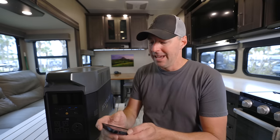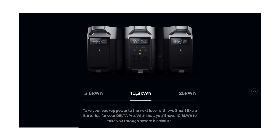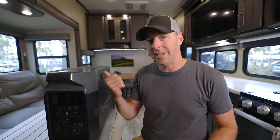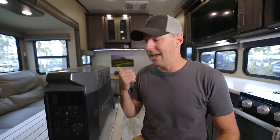If you tried to duplicate our external battery setup, adding one extra battery would bring you to just over five and a third batteries worth of capacity. You can actually scale this all the way up to 25,000 watt-hours, which is a huge system. For RV use, when we first tested this out we were running AC. We were able to go all day — the AC wasn't running continuous, but it kicked on and off. With the extra battery and watching your power usage, you can go for multiple days.